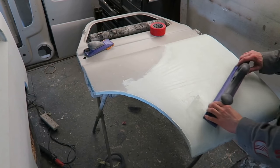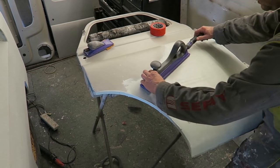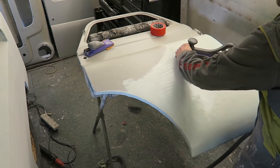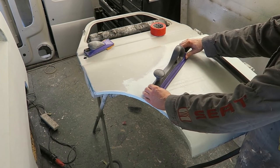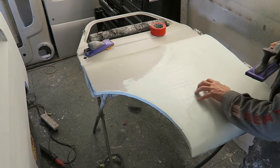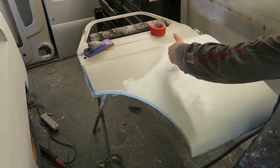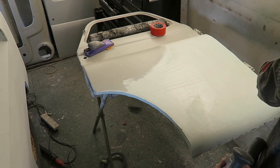It's so smooth. So when I rub down with a long block, I normally go across like that, backwards and forwards, two or three times, and then I change to the exact opposite direction. What this does is, as you draw the block across, you put like a toothed finish on the filler. So imagine there's all these teeth running along this way, and then when you go across in the opposite direction, you knock all those off, and this accelerates the rubbing down process.